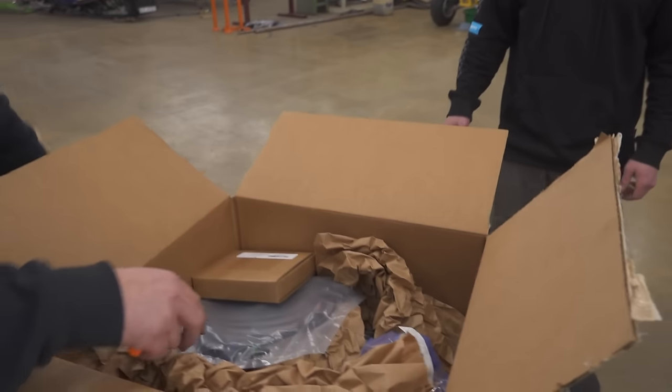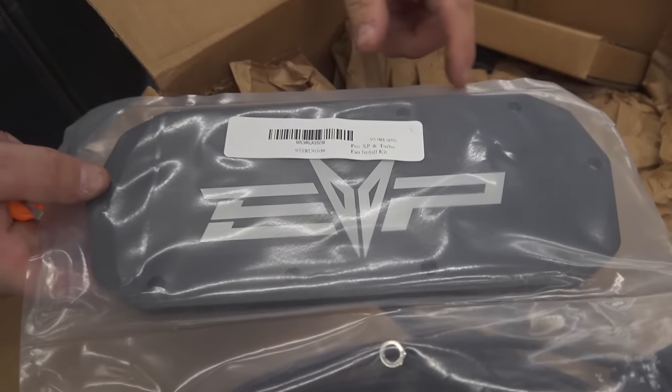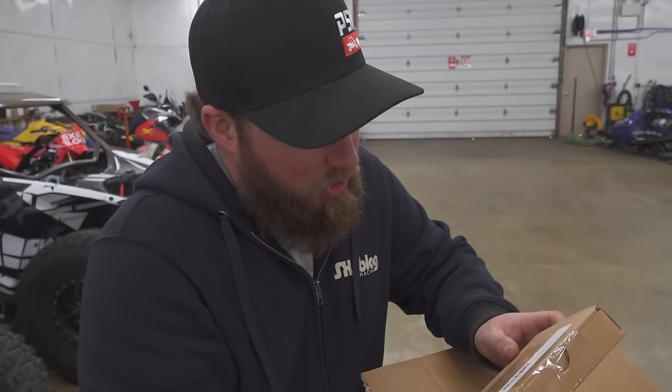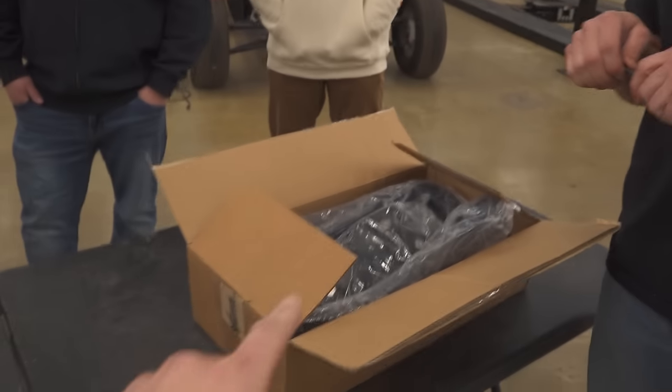Okay, nice packing paper. Looks like we've got the fan elbow and your block-off - so you're removing that intercooler brick, which will definitely free up some air inside your intake. Oh, and new injectors inside of there. New injectors, interesting. Wastegate. What kind of tune is this? So we got bigger injectors - that's why Justin's over here trying to open this box and distract us. We got the big injector bundles, bigger injectors, and a fuel pump with a surge kit.